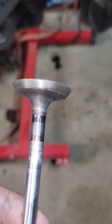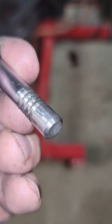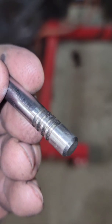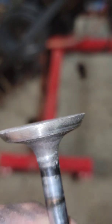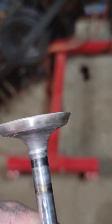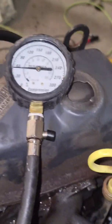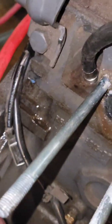Since this is a solid rocker cam stock, I'm going to take a little bit off the top of the valve stem here on the bench grinder, just because we did settle that seat in a little ways. I want to make sure I'm not cracking the valve when it's supposed to be shut. All the other spark plugs are pulled and that's cylinder number four - the one we had to do that valve work on.